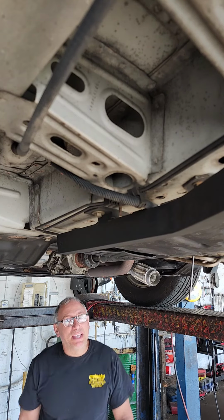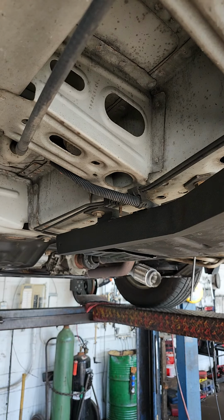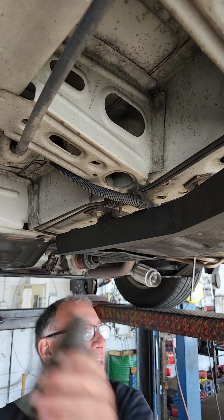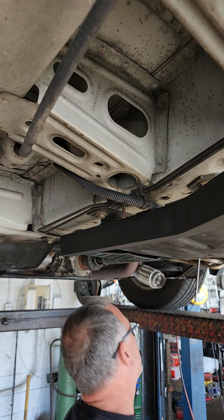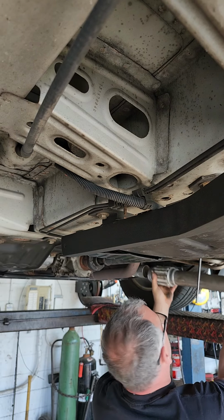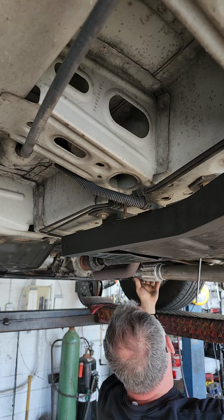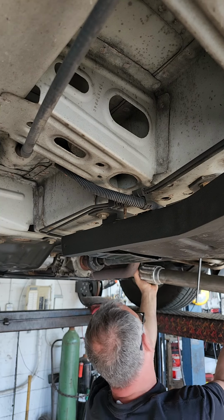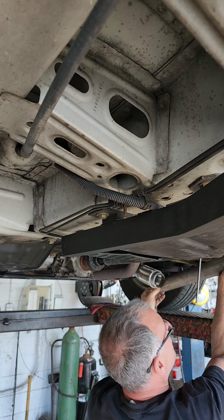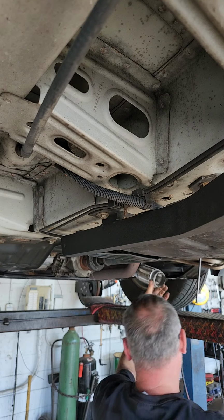And it always happens that when I go to grab the welder, that's either the last bit of wire or the last bit of argon. Yep. So we shape this just a little bit. Let's see if this fits in here. These universal cats aren't exactly 2.5, even though they say they're 2.5, which pisses me off. So now I have to go in here and massage this.